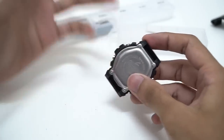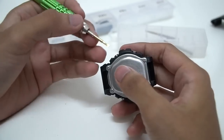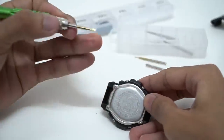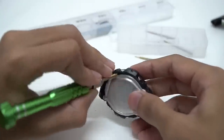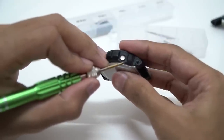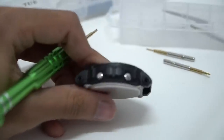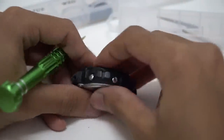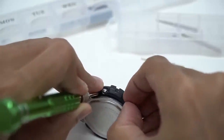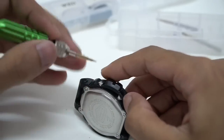I already removed the screws, and all you need to do now is pry it — this part is very hard if you want to do it properly. Since I'm on a budget and don't want to purchase more tools, I'm just going to force it. Put the Phillips head screwdriver in there just below the button. The crucial part to be careful of is the region just below each button — that part is tiny and easy to break if you over-force it. Push the button if necessary and use your nails to pull the bezel up while pushing the button down.